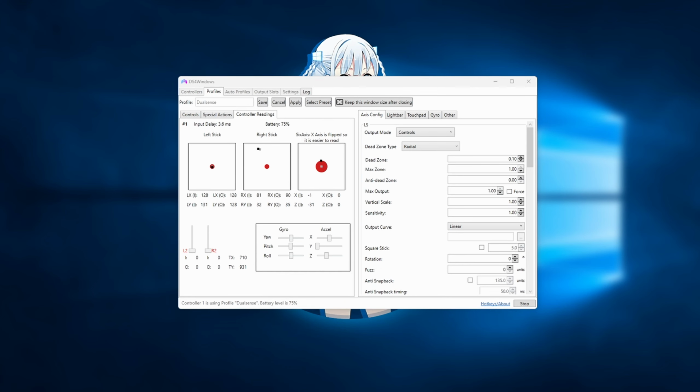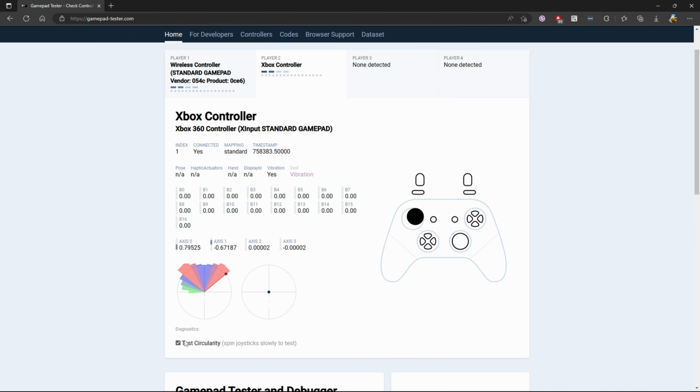However, what I see is, regardless of how I tune it, my maximum value never gets over the original value. On another side, I can always recalibrate this in Windows or Steam. However, the joystick readout is done by potential reading and it has accuracy limitations. Before, on 256 levels or 8-bit, it needs to move by 19.5 mV for a level. Now since it's reduced by around half for a full range motion, even if I recalibrate, I will only have 128 levels. 128 levels is still workable for me, but it also means I will be less accurate and this doesn't sit well with me, given the effort I need to spend on this mod.